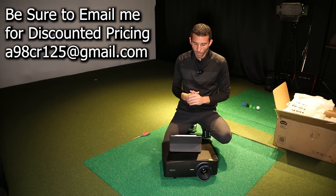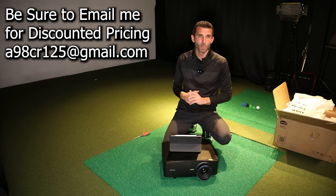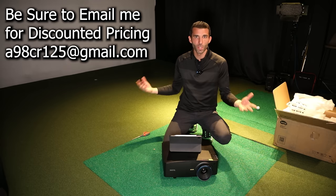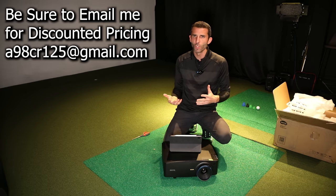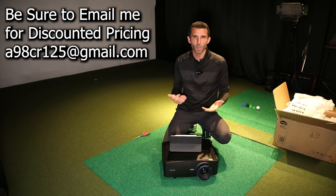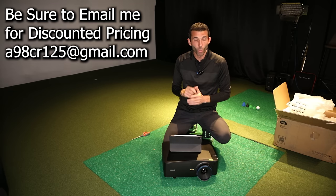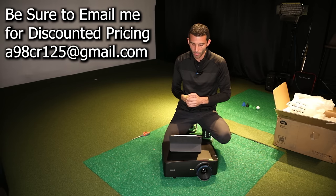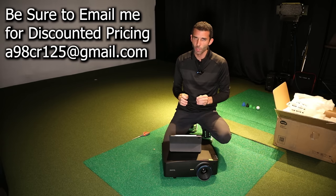Very cool stuff. Cinema grade 92% REC 709 color gamut, plus DLP technology, so you know your image is never going to yellow. The short throw lens, I was correct, 0.81 to 0.89, which means that you can do that 10 feet away at 12 feet, and then I think at 12 feet, it's like 14 feet wide. So huge image from a short distance, okay? Just depends on where you're hitting the ball from is probably what you're going to decide on that. 1.1 zoom, so depending on where you're mounting, if you need to do a little bit of a digital zoom, it has that available.